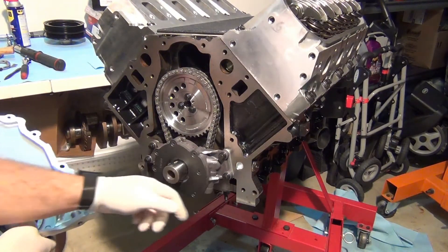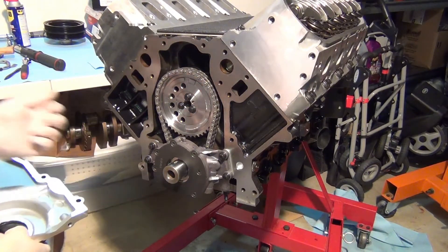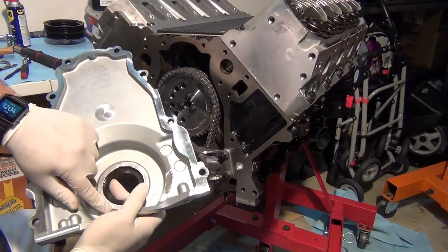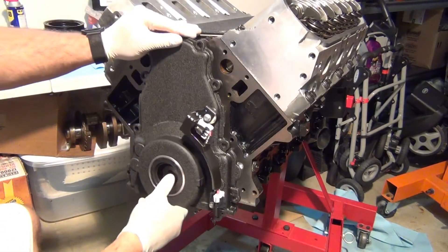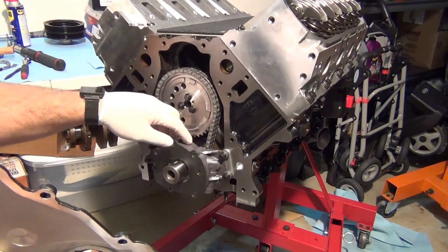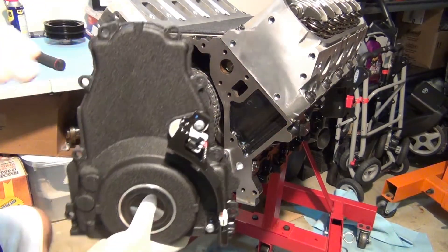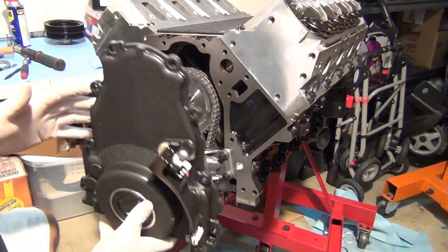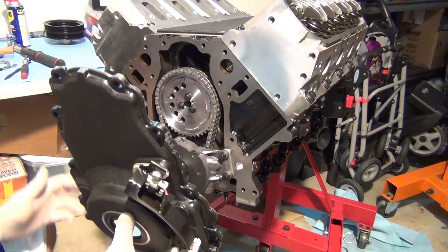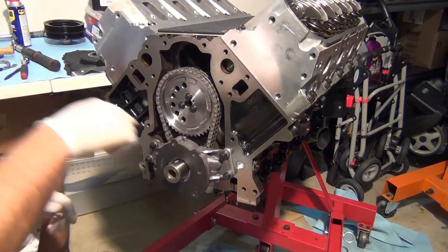The support beams on this pump were hitting, so you can see I ground down right here, right here, on the other side, and where the pickup tube goes — just a little bit on the edge. On the front cover I had to trim down a little bit here, a little bit here, and around the edge, and that got it to where I'm able to sit it on there flat. So just know if you're going to go with the double roller and this Melling pump, you're going to have clearance issues. It's not a big deal as long as you have a Dremel tool — shave off a little, put it on, check where it's hitting, and repeat until it sits completely flush.